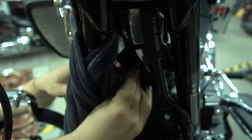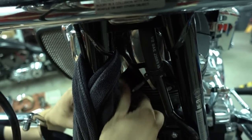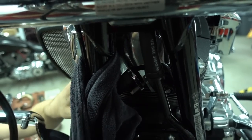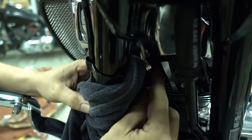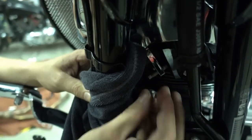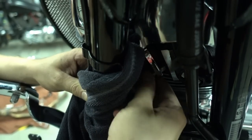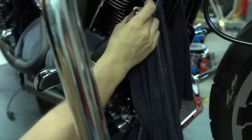And you have to align the plate with the 2 bolts which are already in the engine, and then make sure the exhaust is properly seated in the cylinder head. So I've seated the exhaust properly in the engine in the port and put the flange on. Now we just put the nuts on. It's pretty simple. First one. Now the second one here on the top, same nut. Put it on here.